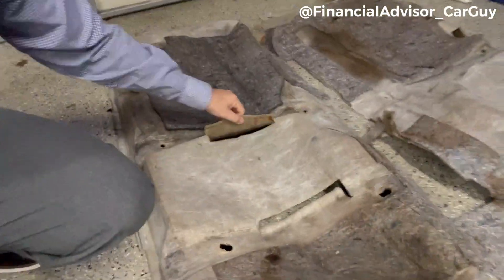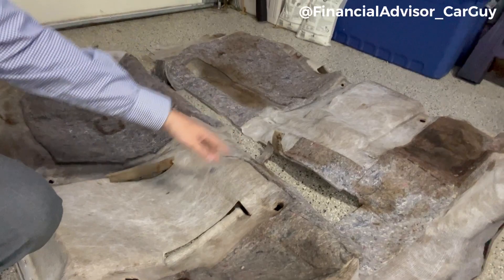In the carpet you'll see there are some cuts, holes, and slices — basically where the harnesses come up, for power seats and things. But this car doesn't have power anything: no power windows, no power seats, none of that. The only wire coming up through those slits was for the seat belt chime. So with the seats out, the carpet still in the car, I took a couple of screwdrivers and propped the carpet up vertically in two spots on the driver's side and passenger's side, then physically sat there with my heat gun blowing hot air underneath the carpet.